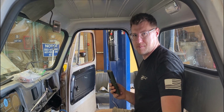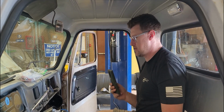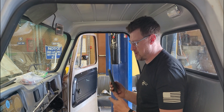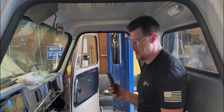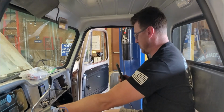Added a piece of pipe to the header so that the O2 sensor is not in free air. And we went through the wizard and found out that I'm an idiot and selected the internal map sensor on the Holley, but we're not using that, so that's most likely why it wasn't starting. So here we go. Let's turn the key. Let the Holley boot up.